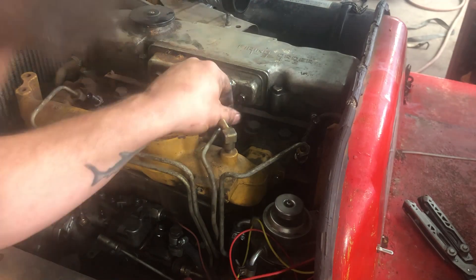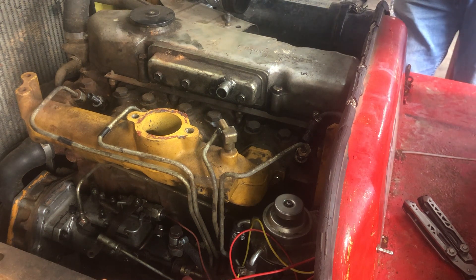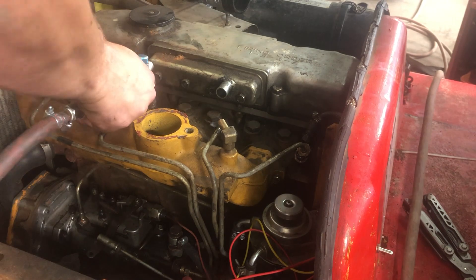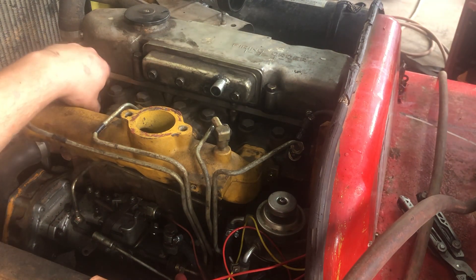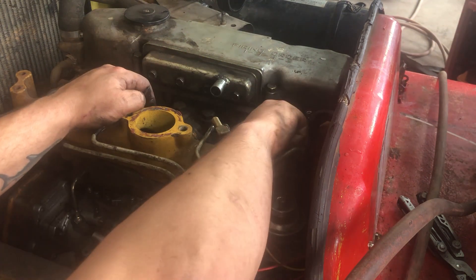Make sure that you get those gaskets — you probably won't need them, but your new injector should come with them. Keep them just in case; they make a good spare to have some of those little crush washers. We went ahead and blew out all the area around the injector just to get all the crud out.